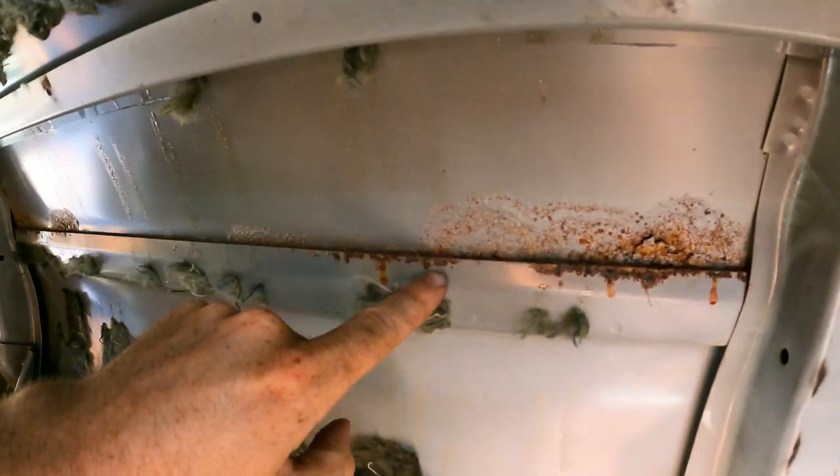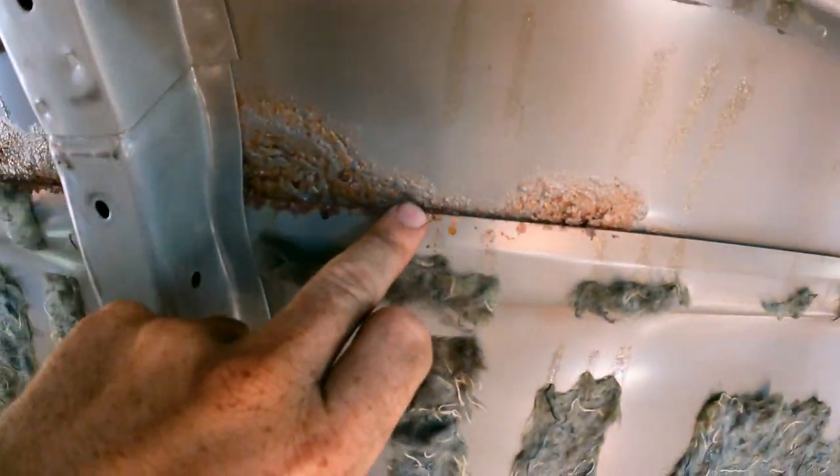This is kind of why we persevered with this thing. I'm going to show you basically what our main problem is on the roof. I think this is the problem with most coasters and also Land Cruisers. You can see there's a seam here — basically what happens is there's a guttering system at the top and if the car stays still for a long time in the rain, water pools in that guttering system and rusts it, especially if you're close to the ocean. This thing was built to go onto the sand and has had its life in far north Queensland touring on the sand, so while they've looked after the chassis really well, it's the roof that is currently the problem.